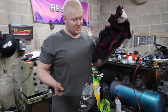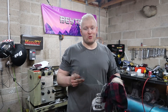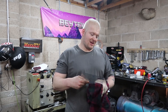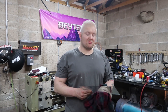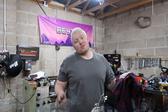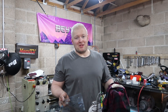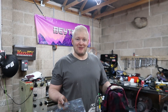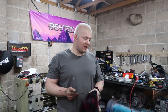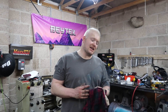But in true fashion I'm just going to have to try and send it anyway, see if it makes a difference. If it holds, it holds. And if it doesn't, it's just going to have to live at a bar of boost. And if it keeps pulling coolant pressure, I'll probably have to get another block or another engine, which sucks. But to be fair, the guy that sold the engine didn't know if it was fucked or not — it wasn't a stock car, which tells you it's probably lived its life at 9000 RPM. So we'll fit the head gasket and the big head studs and just see how it goes. We'll have to test these things — it's deformed just now, but by the time you've torqued the head down onto it, it could pull itself straight.